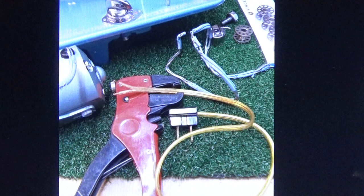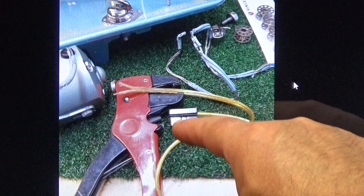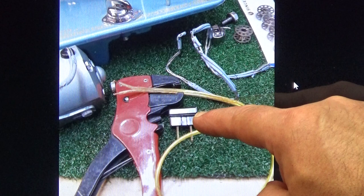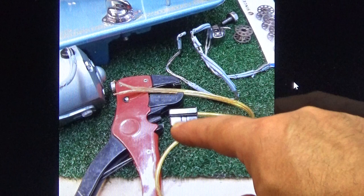So here I'm beginning the wiring process. I'm trying to get that wire for this plug-in junction ready to be plugged into the block, and getting that entire assembly set up. This particular type of plug-in requires that you do not strip the wires. I've got my stripper right here for one end of the wire, but the end that plugs into here, there's actually going to be some very, very sharp metal prongs that are part of this assembly, where you have to very carefully press the wire into those prongs, and then they pierce the outer coating, and then they go right in and make contact with the inside copper wire. So it's a different way of setting it up on this end than on this end.